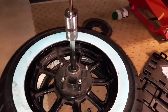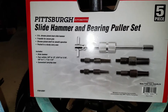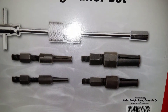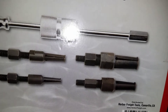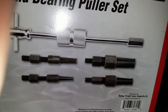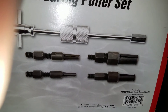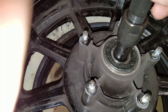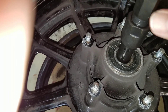On the rear wheel it is not that simple. This is a device I had to purchase — I got it at Harbor Freight. These pieces are called collets. I got the second largest one, which is from five-eighths to one inch, which is the one you'd need. Basically you slide that in to grab the inner edge of the wheel bearing, and this little piece grabs onto the other side of the inner race.